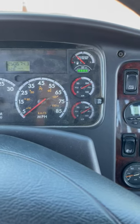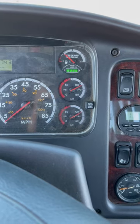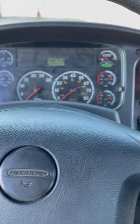Wait until your minute is over. My minute is done. Do not release the brakes — you need to re-read it. My needle is still reading 110 PSI. That is a good test.